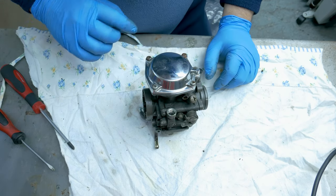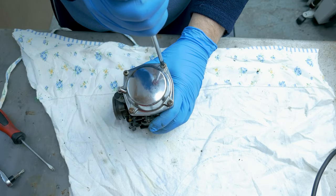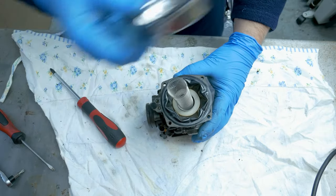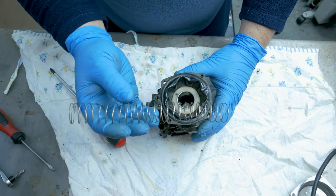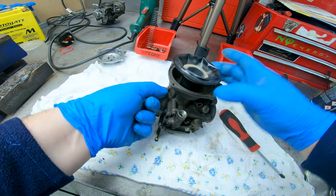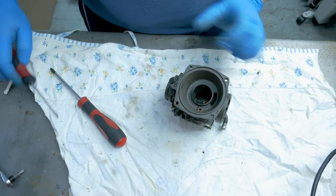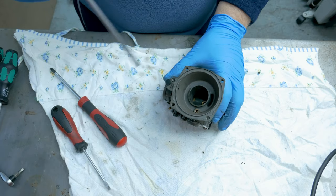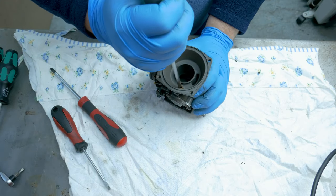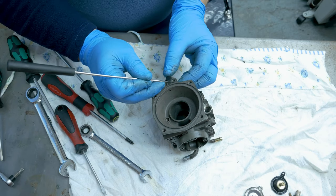Let's take out that delicate bit which is going to be the membrane. What the heck - it's got a security torx on it! Wasn't tight though. Looks fairly clean. Take the spring out of the box and then we're going to pop this membrane out. There is an air jet there - I'm going to pop that out. The correct size screwdriver - the maximum which fits into the jet in my case is a 5.5mm screwdriver. We're going to give it a firm turn. There's a little o-ring here.